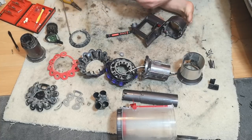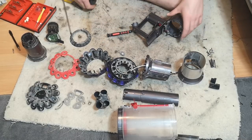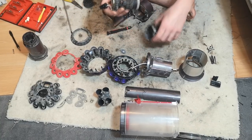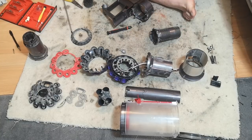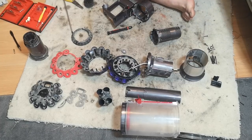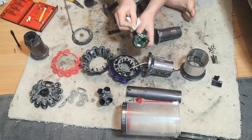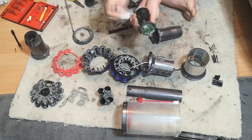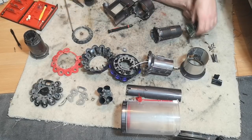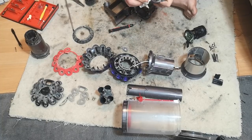This is the foam from the end of the motor. You can see all the dirt that's passed straight through into the filter, which is why the filter is so disgusting. This is the speed control board which pops into here, and its rubber seal is completely covered in crap as well. Then that just plugs into the board. We'll give it a good wipe out. Those two screws in the side are how you get into all the switch and whatnot - but we're not going into that; we don't need to, that's a step too far.